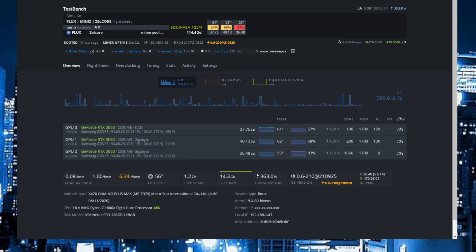So now we are back again, and what I forgot to mention before is that I use MiniZ as the miner. What I needed to do also is restart the miner — stopped and restarted — just to make the overclock settings apply a little faster. I can't tell you why, but in MiniZ the overclocks take some time to apply, so the hashrate is jumping up and down a little. Right now you can see the overclocks are set.